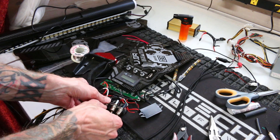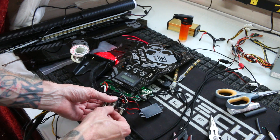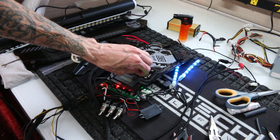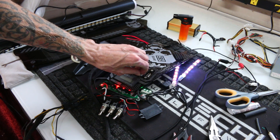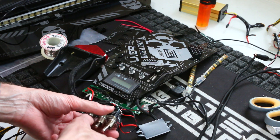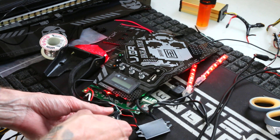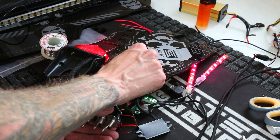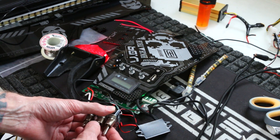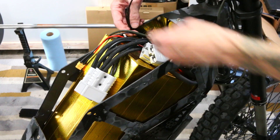After a ton of wiring I finally got it to work after multiple iterations of thinking I had it, checking it, and needing to switch a few wires. My 12-volt rail switch is working, my light switch is working, my RGB switches are working, the rotaries are controlling the RGBs, and my pilot lights are working. A lot of the time I spent on this wiring was just me figuring out how I initially wired it up - I think it would have been a lot faster had I just started over and rewired it from scratch. I guess that just goes to show that I've learned quite a bit in the past three or four years since I originally made this bike. The bottom line is that it all works, all the dash components work, and I'm very happy about that.